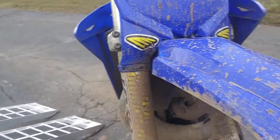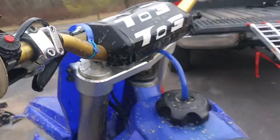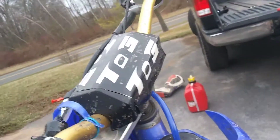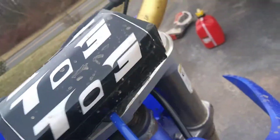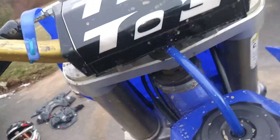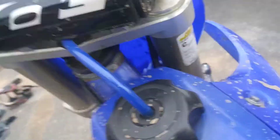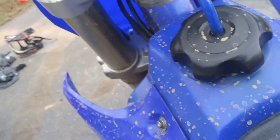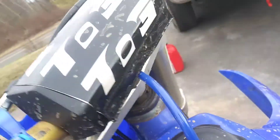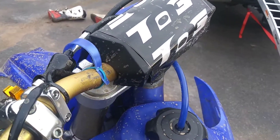Some fails for the day - listen to this. Of course it doesn't do it when it's on the ground... When the weight of the front wheel is on the ground you have to do this. Hear that? We need new steering stem bearings - those are shot.